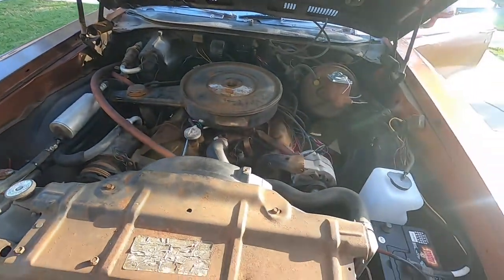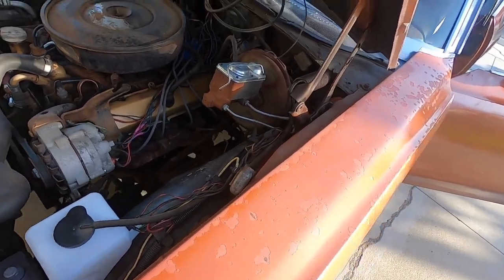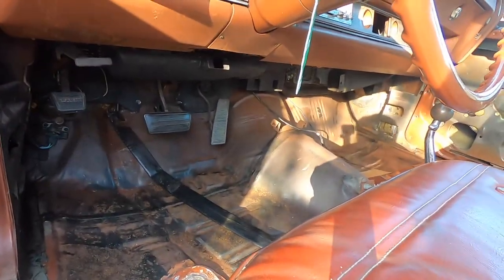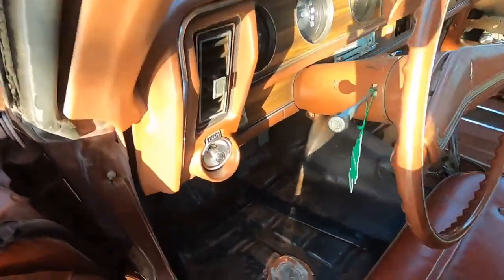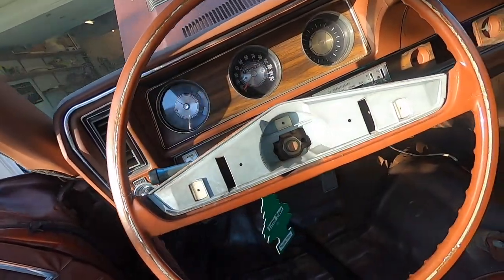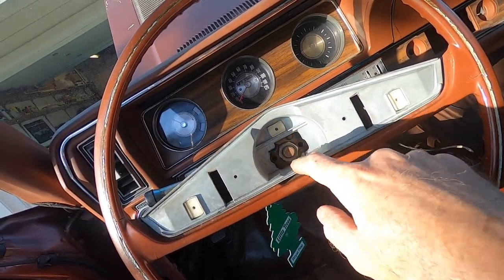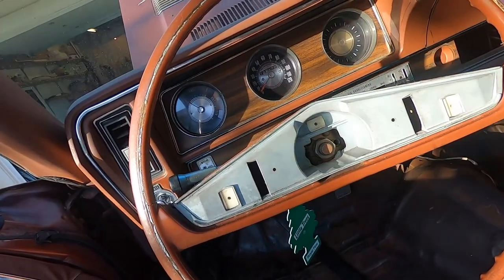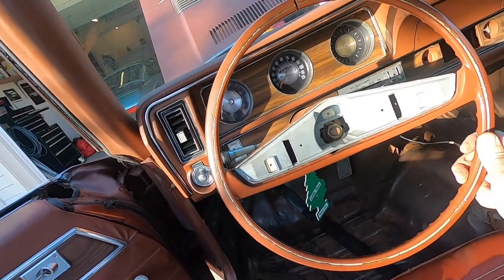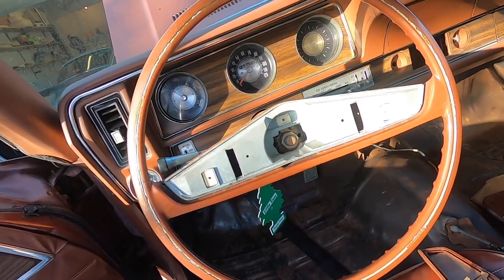Okay folks, so that is no longer in there and disconnected from the horn relay. So Junior actually took the button out from under the dash. So that's good as well. And the part I was talking about here in the horn pad is actually here, where you would have a pin and a wire coming up to the ground here, so that whenever you hammer on this thing, it throws the horn on. So those are missing. And I was thinking about potentially replacing this wheel with a sport wheel, and still on the hunt for that too. So if anybody's got one, let me know.